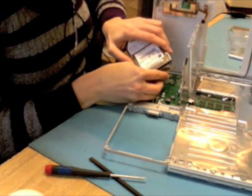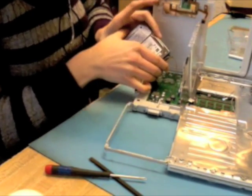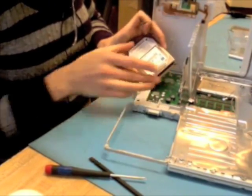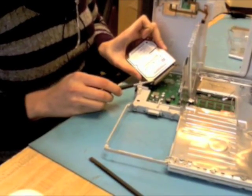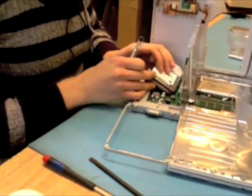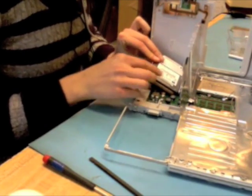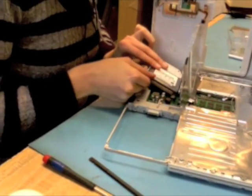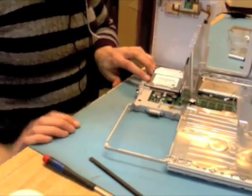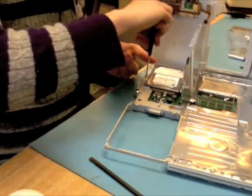So now I'm just going to go ahead and put it back as gently as we took it out. I centered the flex cable on all of the pins before pushing down, and you'll notice that I started on this side because I wanted to take extra care around those pins that had been previously bent. So we don't want to lose the data on this machine. And I slide the carrier back in on the front side of the drive, and I slide those 2 T8s into the carrier on the back side of the drive, and it is nicely evenly reseated in there.